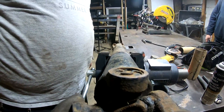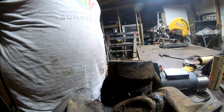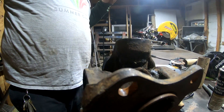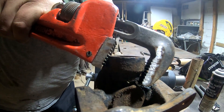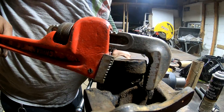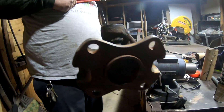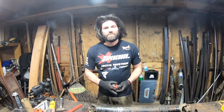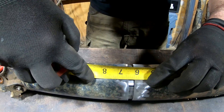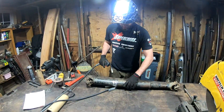Let me show everyone what I'm looking at. If you line this up and work it down right about there, you can see that it's just a little crooked this way — we've got to twist it just a little. Go ahead and give it just a little turn. It needs to go a little more. Of course, if we go too far you can always go back — it's not welded yet. That surely did it. You guys drop down and just make sure it's lined up — we're good. You can see I left a gap here because we want to join both these pieces and our inner tube there. I figured a quarter inch but I went a little over — almost at three-eighths. Settings seem pretty good on the welder, so I'm just going to go for it.